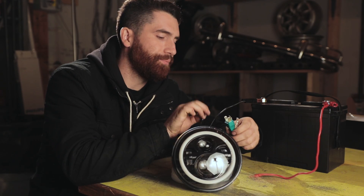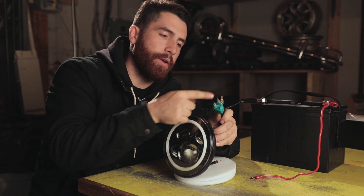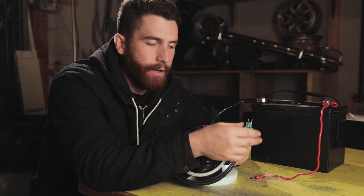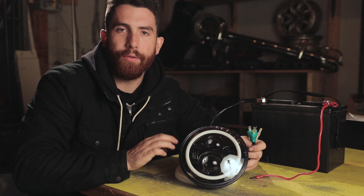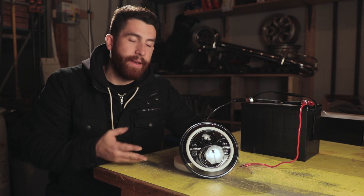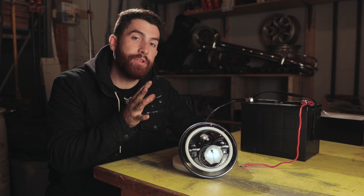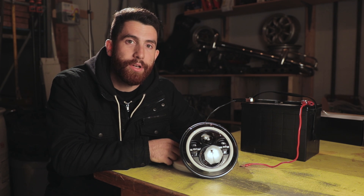Really simple, very easy to wire. Just plug it in and then your choice how you want to run these two wires and what source you want to get them from. Because the ground circuit is done by the main plug, it's really simple — you just need to run one wire from whatever source you want. And that's it for wiring up the headlights. If you don't know how to install headlights in a Classic Mini, we have a video on that — link's in the description. And if you're interested in purchasing these lights, just visit our website, stevestonmotorco.com — they're available there for purchase.